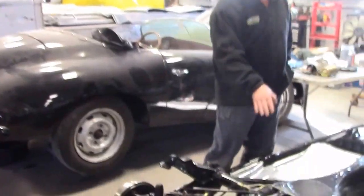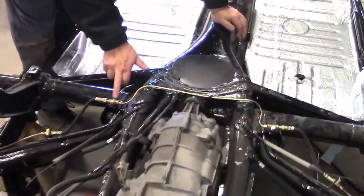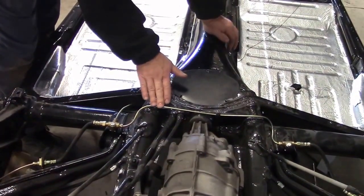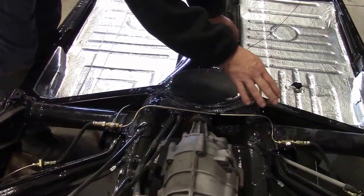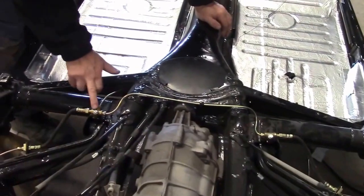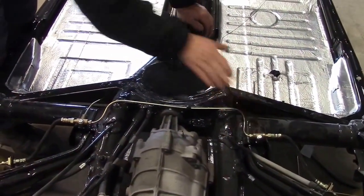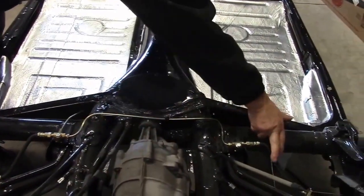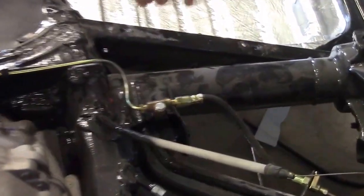We went ahead and made all new brake lines. It's quite dusty here, I apologize. You can see we have our new junctions. There's quite a bit of water damage — this car sat for a long period of time — so we had a lot of rust between all of the brake lines and the old master cylinder. We've made our own lines and replaced the T and junction fitting with brand new Volkswagen brass fittings. You can see we have new hardware, new flex lines, and new metal lines.